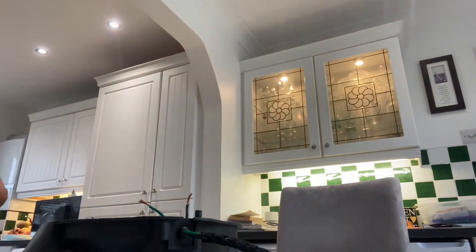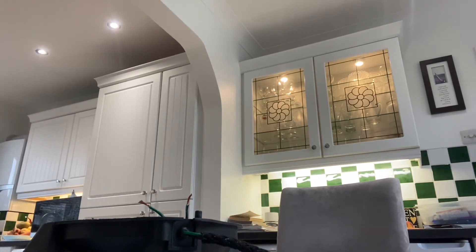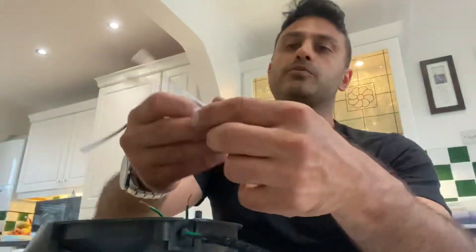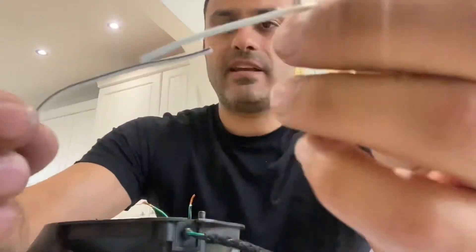Take the wiring that came with the new speakers because they're already crimped and have plastic on them — just nip them off. It's the same as the Mercedes wiring: the black stripe is negative and no stripe is positive. But that's for this particular speaker — if you're happy to install at this point, you probably don't need me anymore.